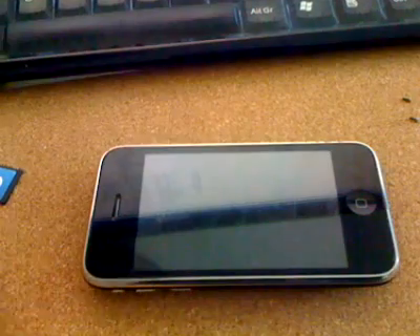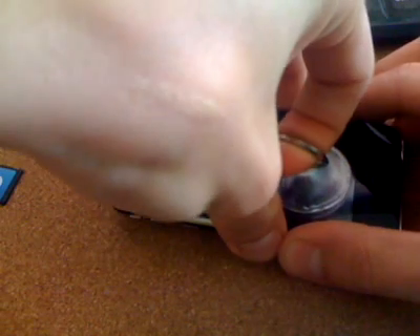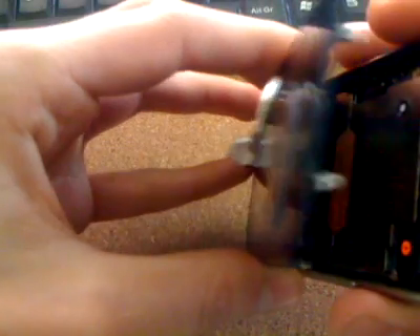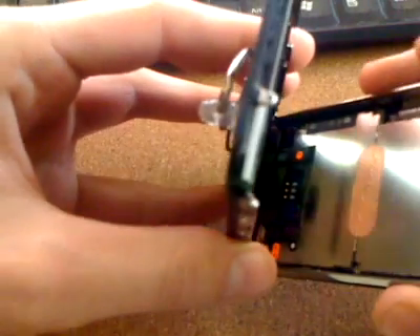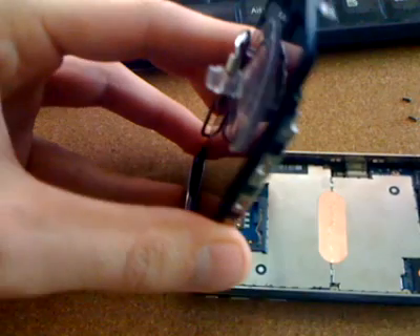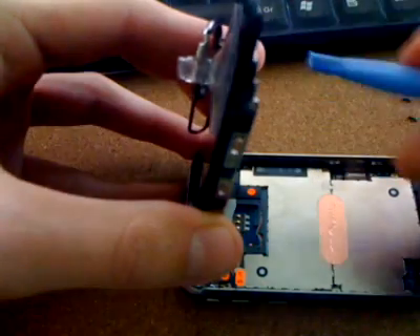The iPhone is off. You want to lift the suction pad off. Be very careful when pulling the LCD off, as there are three ribbons at the back and you don't want to break those. There we go — and as you'll see, the three ribbons are down the back there, and one will pop off straight away.